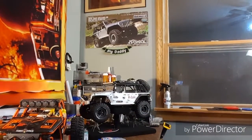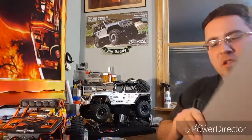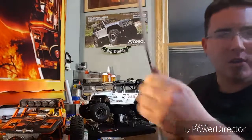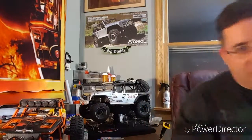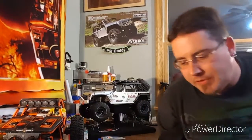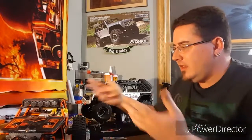That way instead of having it all open, it keeps debris and crap out of the back of the truck. You can see that black part at the bottom - that's just to keep extra debris out. It's just some plastic I had laying around from a sign bar at my job that they were throwing out. It's about an eighth-inch thick plastic. I scored it with a razor knife a couple times, made little panels, drilled a couple of holes, and used zip ties to hold them in. I didn't have to do it, but it helps keep the extra debris away from the ESC.